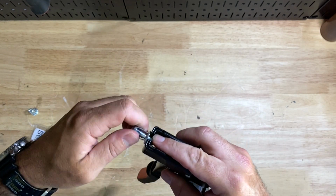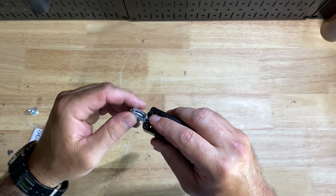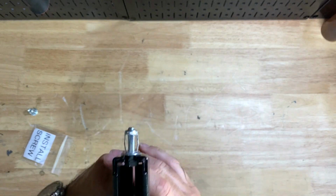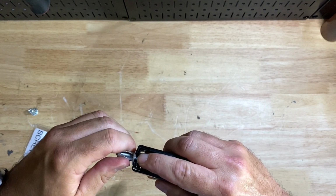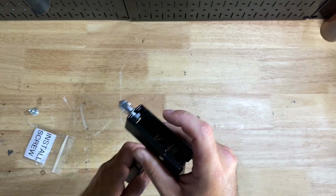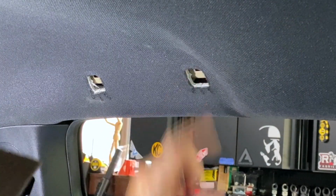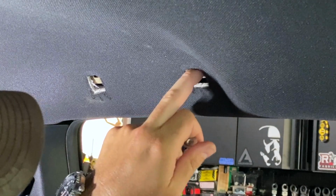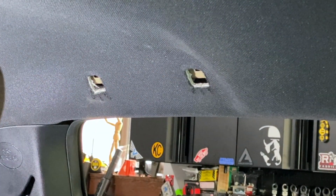If you hold the bolt, thread it down as much as you can, it'll make it a little tighter in there, and it'll stay in there, and that'll help you guide it into the center better. So just hold the bolt, screw it down as much as it'll go, and that way it's not loose, not all flimsy flapping around in there, right? Then put it in. That'll help you get it in the center. So, square hole, round nut, you want to make sure it's in the center. It's gonna help when you align everything later on, okay?